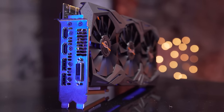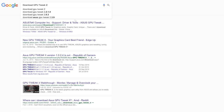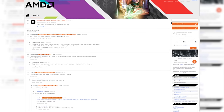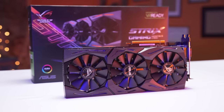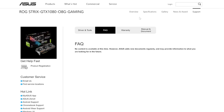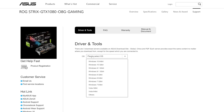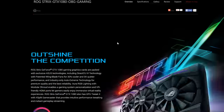There is an elephant in the room here: the OC mode isn't enabled out of the box, and there's no hardware BIOS switch to turn it on like the 6970 back in the day. It has to be enabled through GPU Tweak 2, ASUS's software utility. Problem number one — this utility isn't that easy to find. Searching for 'download GPU Tweak 2' does yield an ASUS download page, but for a horribly out-of-date version. If you want it, you'll need to scroll further to a Reddit discussion thread on how to find it.